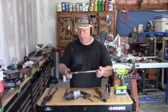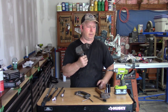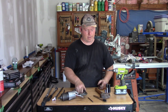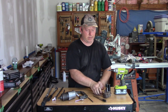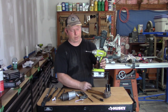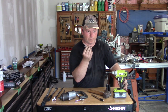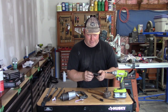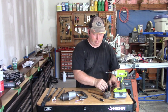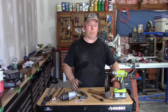You don't necessarily need a breaker bar, but a half-inch breaker bar and a 3/8-inch drive are useful. An impact driver is not required, but if you have one it'll speed up taking wheels off. I have a 4-inch C-clamp. I used a mini sledge for taking parts off — I'll show you that. I also have a small wire brush, which I find really handy. You'll need a 19-mil socket, a 17-mil socket, and a 12-mil socket. A couple of jacks and jack stands would be handy. You can do one side at a time, but I like to do both sides at the same time — if you get lost you can always refer to the other side.